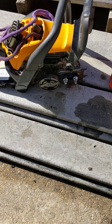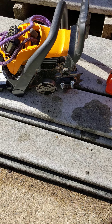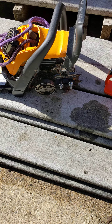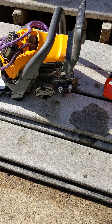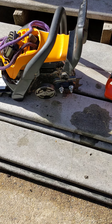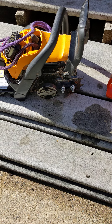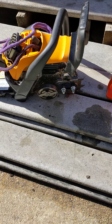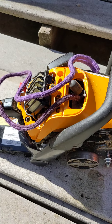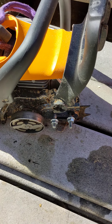It's Sunday morning, April 10th, 2022 — another chainsaw day, great spring morning, supposed to be 50 today. Here's the Poulan Pro 5020: it's 50cc, comes with a 20-inch bar. I've used it a little bit and a rope got down the cylinder, so we need to replace the clutch drum.